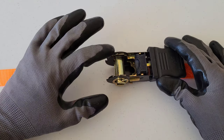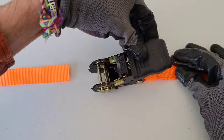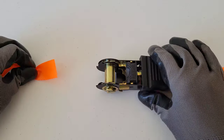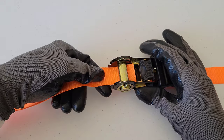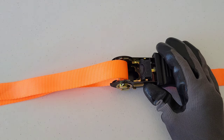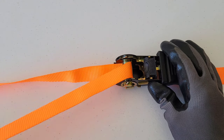Here's the ratcheting part — there's a cylinder in here with a slot, and each time you open the ratchet it moves the cylinder and slot around. We want the slot facing out this side and slightly down like this. When you take the tie down strap and put it through the slot, it will come out the top and it's just easier to get a hold of. Then just pull the tie down strap through and get rid of all of the excess slack.